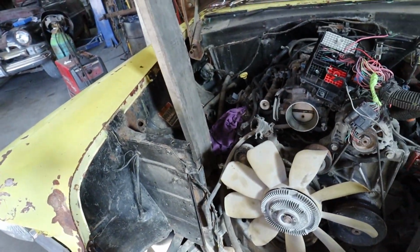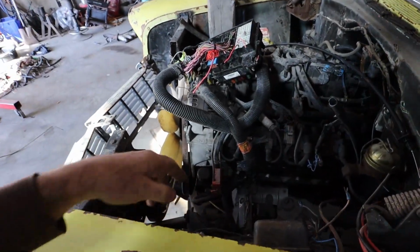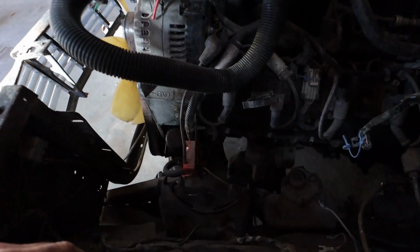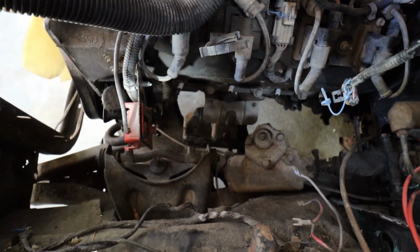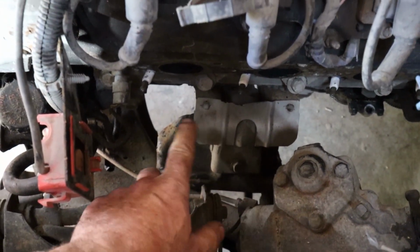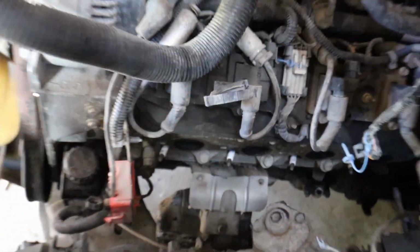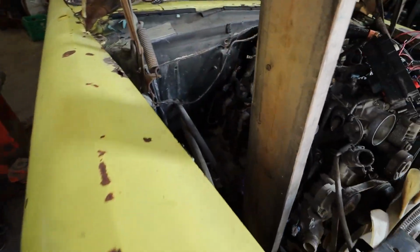He's going to bring a rad. We're going to modify this exhaust manifold, though I did offset the motor a hair to one side, so we'll see. We did reuse, if you can see that, a stock Silverado motor mount that we just welded into place with some outriggers. Nothing fancy, we're reusing all the GM stuff there.